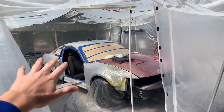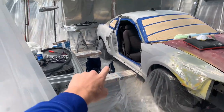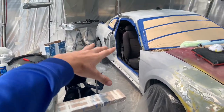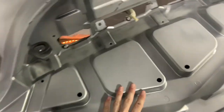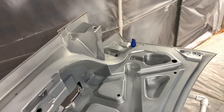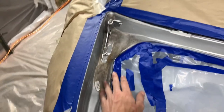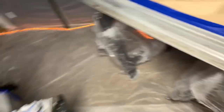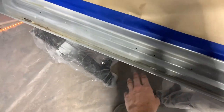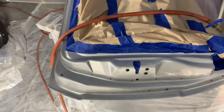We have most of the stuff masked off. We still have to clean the area and mask off the body so we don't paint the body. We're going to do the door jams, the bottom of the trunk, the bottom of the hood, and the inside of the doors, and then put that stuff back on so we can paint the whole outside of the car. We took scuff pads to it and got it all scuffed up — we're just going to go ahead and spray over it. Even though this area is really dirty, we scrubbed the crap out of it and couldn't get it that clean, so we're just going to spray it. There is a little bit of rust on the doors that I need to clean up with a wire brush. We have the door jam things filled and we're going to go ahead and paint the bolts — I'm not going to take it out and deal with all that; it's a pain.